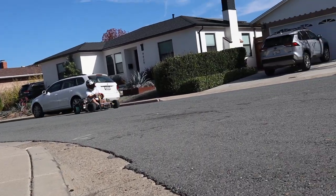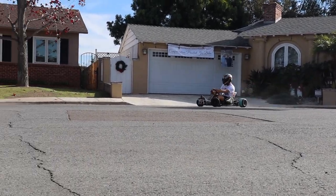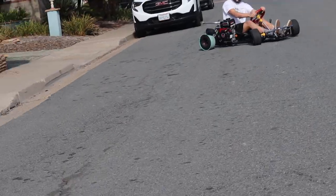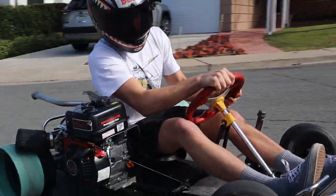The second part to drifting is PVC. That's basically the next step after making sure you have both rear wheels spinning. PVC is a plastic that you slip over the rear tires so that you can make it drift, because go-kart tires are just way too grippy to be drifting on their own. It's possible without PVC, but you don't get the bigger, longer, high-speed drifts. Go-karts aren't making enough power to make the rear wheels slip with how much grip they provide, especially a kart like mine with bigger, wider rear wheels.